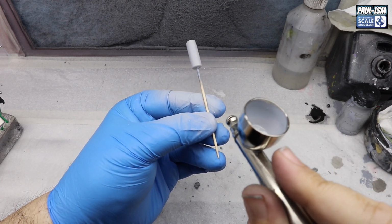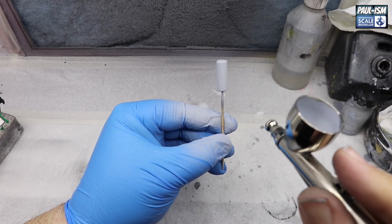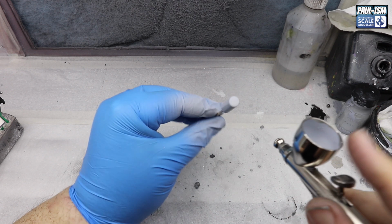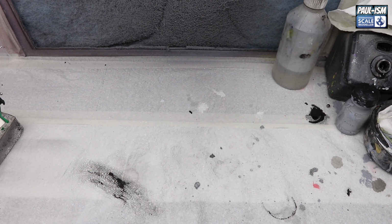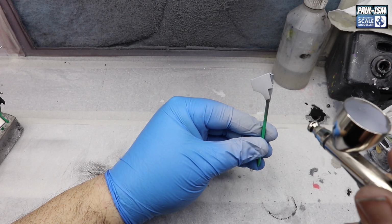We've got our 0.35 Apex this time for the acid etch primer. And this primer, it's just a joy to spray. It covers unbelievably quick. It's a very satisfying paint to spray. It's quite hard to describe, but because it's quite a thick paint, it just lays down beautiful. It's completely unthinned out of the spray can. It's just been decanted, left to off gas, and it is very, very volatile out the can. So be very careful.